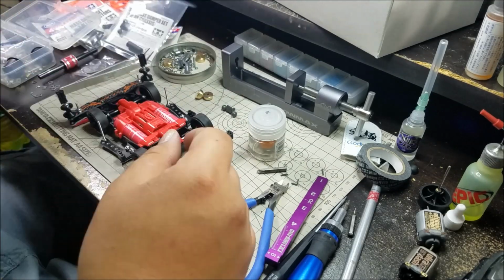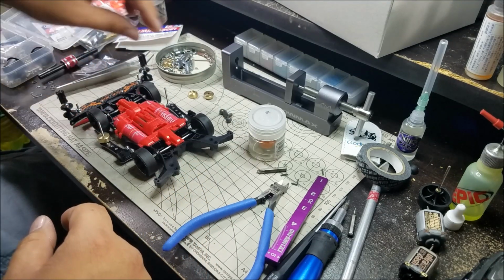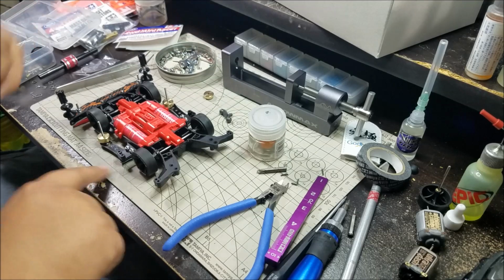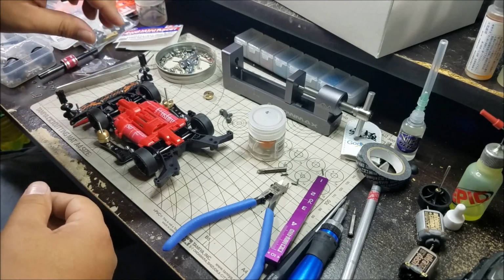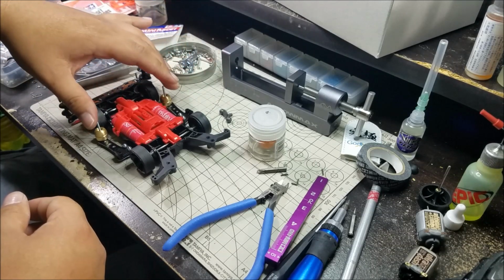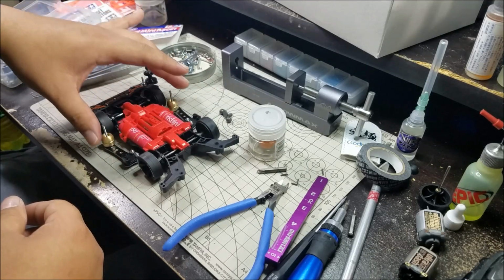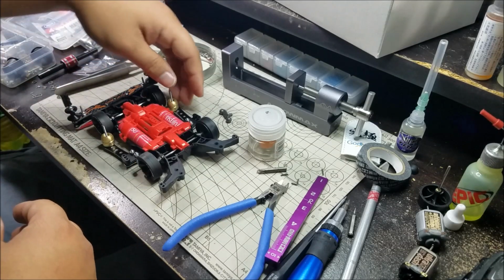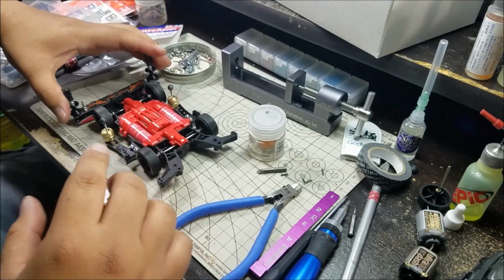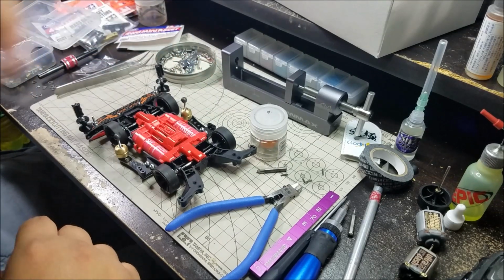Okay, so let's go ahead and seal up these mass dampers. Yeah, the heavy side first. Put the heavy ones in there. In addition to lowering the mass dampers a little bit, what that allows the mass dampers to do as well is to give it a little bit more flex. Even though it's kind of stiff the way that it's mounted, it's very, very strong, but this gives you a little bit more flex, and that allows the dampers to work just that slightly little bit better. Okay.